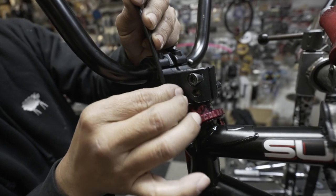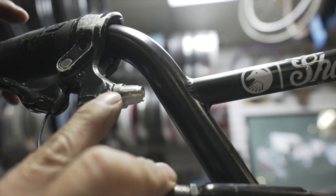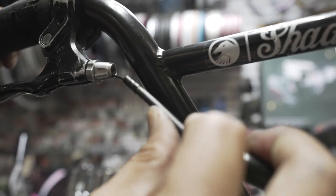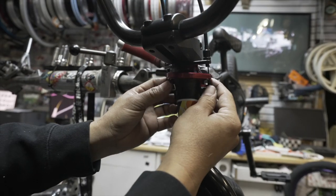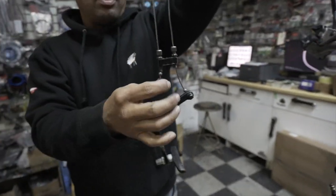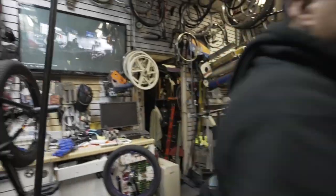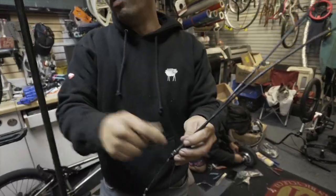Put it all the way down, because after you're done you're going to adjust. See that little slot right there on the barrel adjuster? Line it up — beat it through, see how it goes right through? Loop this one in. It's going to be a little loose right here. Now I'm going to do the lower one. The brakes are on there — just ignore all that. This is Alfredo's bike we're putting this on. This right here is a London mod or dual cable setup. You guys could either run that, or you could run the reverse version, which is a two into one. That's all preference.